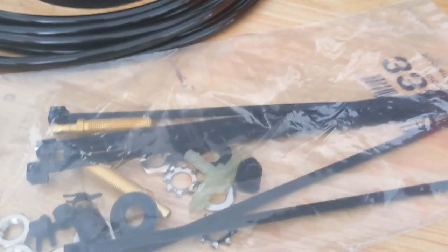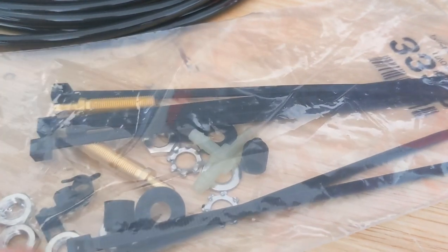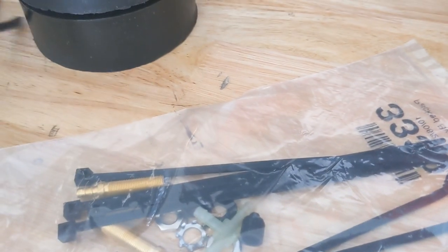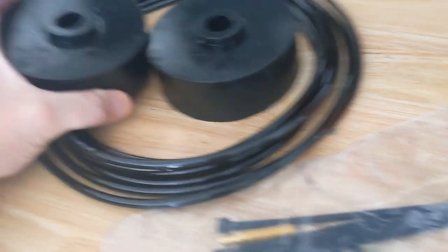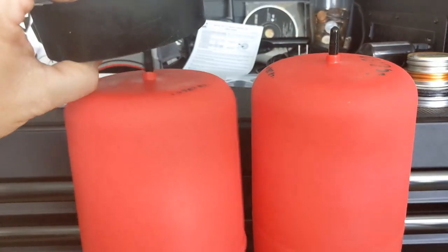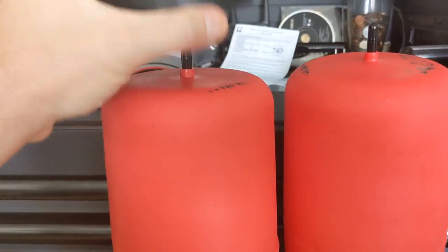They give you a T-fitting as well, so it's optional — you can run a fitting on each side and pump the bags up individually, but I don't want to go that route. I want to run them to the back to a central location, use a T-fitting, and one air fitting, so when you put air in it inflates both evenly. The trick is to use the exact same amount of airline on each side for proper even inflation. These caps insert on top of the spring — the airline comes through a hole so when the bags inflate, they hit these caps, raise your truck.